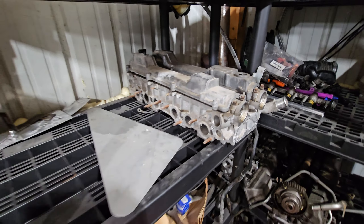We are going to have to pull the engine, and one of the big reasons I'm going to order the T56 is because I only want to do this once. It's a nightmare to get in and out of this car, especially with how particular I am about keeping it pretty. I'd rather spend the $8,300–$8,500 right now on a T56 to put it on the engine when it goes back in. I have to pull the engine to do the oil pump, and to do the oil pump you have to drop the sump — can't be done in the car. We'll drop the sump and put a VVTI oil pump on there so we have a crank sensor and can do proper trigger points.